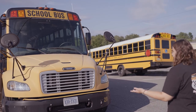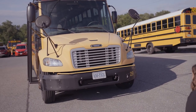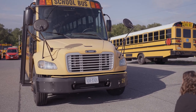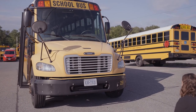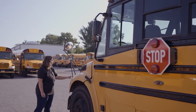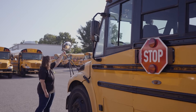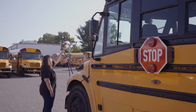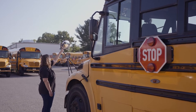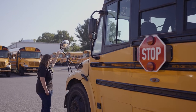My bus is level. There is no black shiny oil. There is no pink or green antifreeze or red power steering or transmission fluid. My crossview mirror is securely mounted. It's not missing any nuts, bolts, or screws. The seals not worn, torn, or frayed. The mirror is not discolored or faded, chipped, cracked, or broken. And my wires not worn, torn, frayed, or burnt.